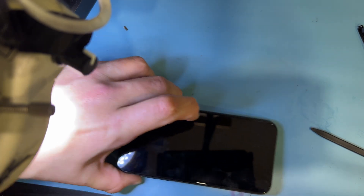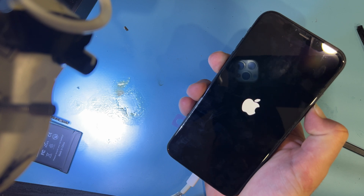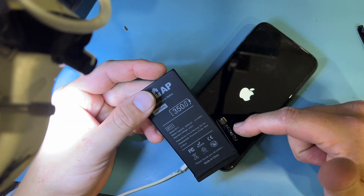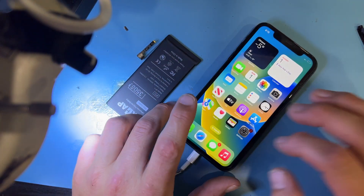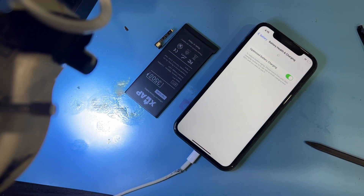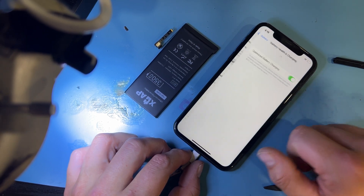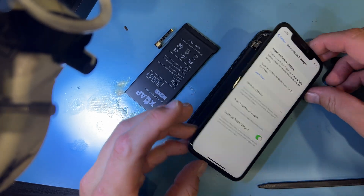Now just boot the phone. Once we get the message — as soon as it says 'Important Battery Message' — at that point we know we can disconnect this battery and reconnect our new one. This tag-on flex you can use as many times as you want, which lowers your costs by close to $10 each time. They're pre-programmed for the 11 series and newer, so I don't have to connect this to a programmer anymore. It's just going to automatically adjust to 100%. Waiting for it to give the non-genuine battery message... there we go. Normally it's quicker than that — it spit out the message I needed. Going to battery health: 100%. Perfect.